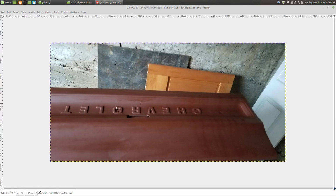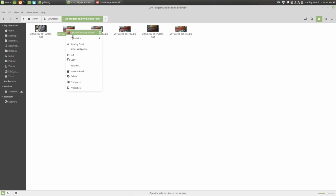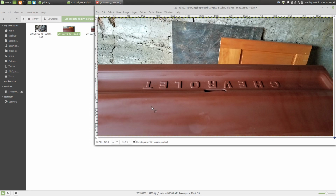But like I said, don't worry about those runs. We'll take care of that. Brandon said that almost all this primer will be coming off again because we will sand it again to level it. But we just wanted to make sure we did not leave it totally exposed to the elements. I think this might be the best picture with the lighting that I was able to get. You won't see the bondo burning through here, because we'll make sure to paint the bondo areas first and let them dry, or use some type of sealer. He was just getting a feel for the Rusty Metal Primer. But anyway, guys, this is basically afterwards. So all right, back to the video.